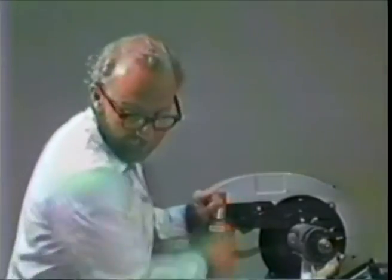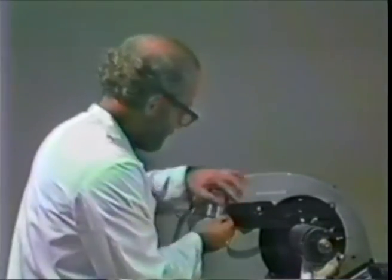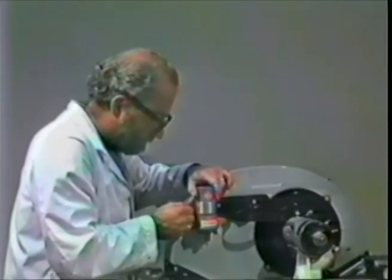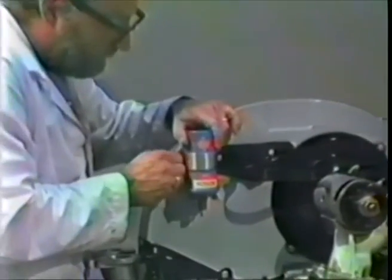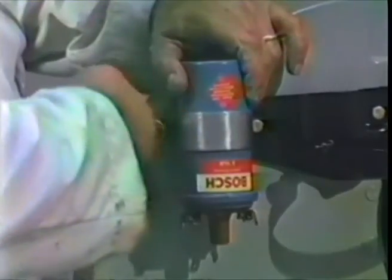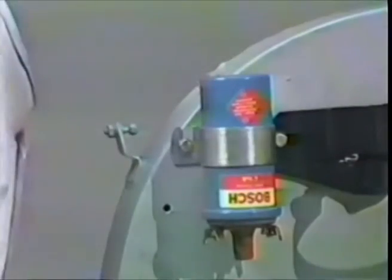Loosely. And then push that underneath like so. But don't let go of it. It'll fall on the ground and generally smash itself and make a mess of the coil you just bought. And these coils aren't cheap. They cost about $17, $18, $19. So what you have to do is get another 6mm bolt, put it in here, have your socket handy, because this one you want to tighten down to hold the coil. Force upwards on the coil to get the washer to grip everything right. Tighten down the 6mm bolt so you can finally let go of the coil, being held by the one bolt.